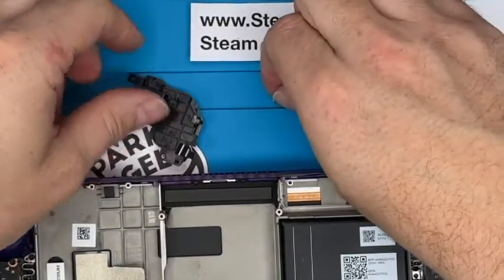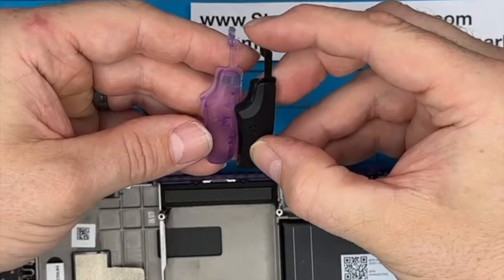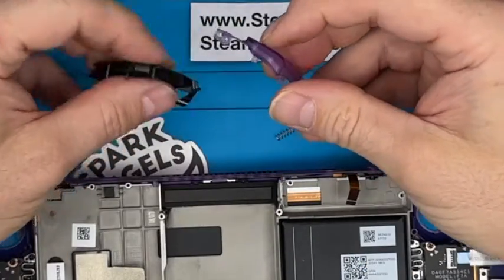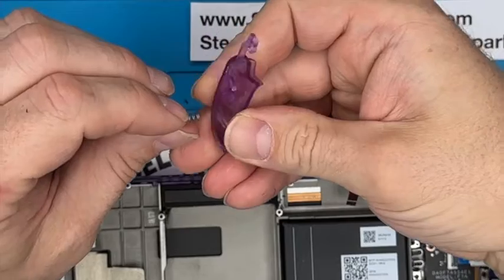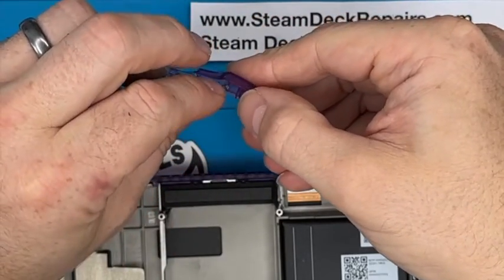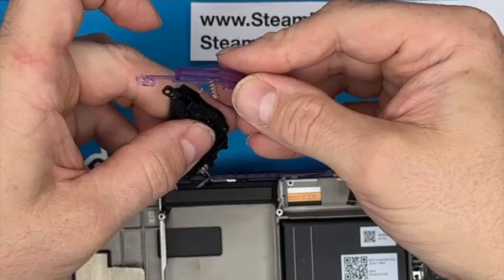So we've got the spring. Right, we ping that out, find the button that's going to be replacing, the L1 button. And this is how we sit it into place. So I'll put the spring on that little crosshair, so to speak, that X. The spring goes on there. That has a little return on it. I'm going to hook that return around.